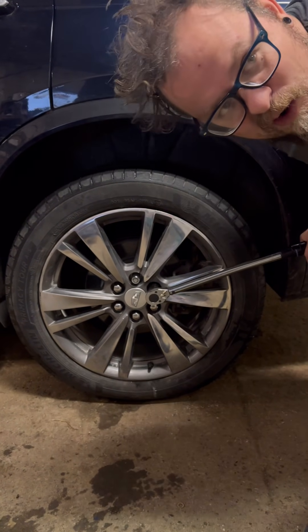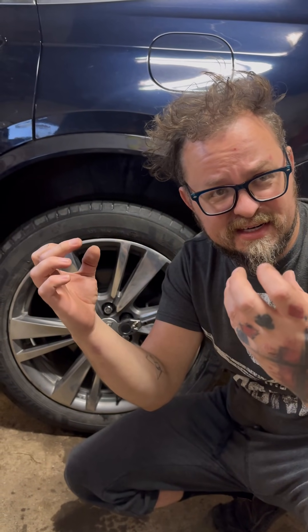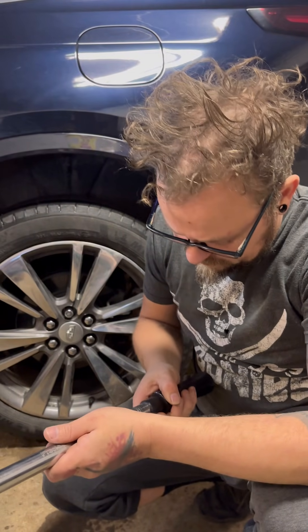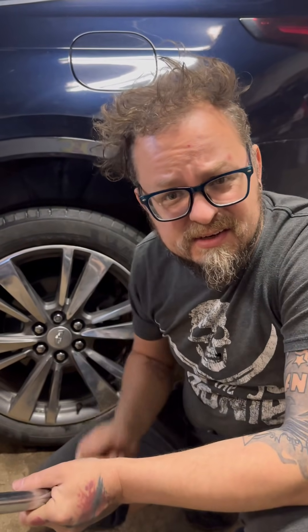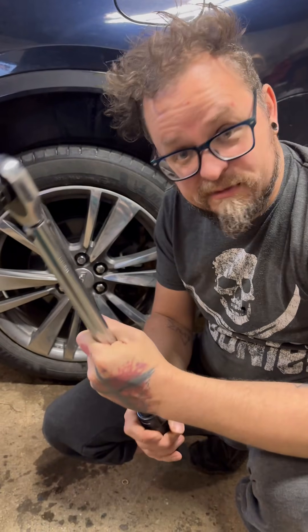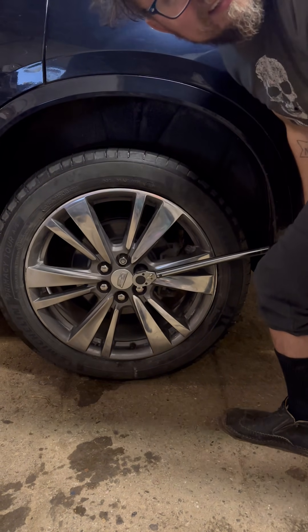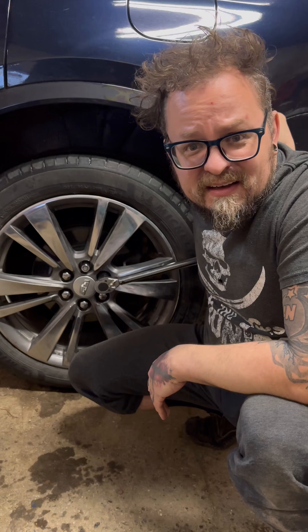It's reading over 190. We've got the newer model Ryobi — the 262 — and even with the torque stick, it's still going up to 200 foot pounds plus. I'm just curious what it's actually at, so let's bump it up to 205. And this is why you always test your torque sticks and buy quality ones if you're going to use them. 205 foot pounds now.